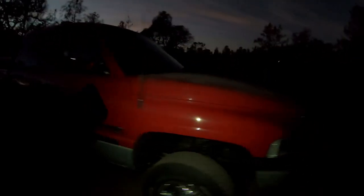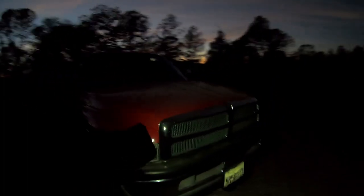And I will tow a tractor or something with this thing. It does feel like it's capable, but we need to add some more power to it. That's all there is to it. She don't have enough juice. Not enough RPM, I would say. I know diesel's got that low-end torque, but this one ain't cutting it. It ain't got enough fuel, ain't got enough boost. And I think I might have a little bit of a boost leak. I can hear something kind of howling at me, but she's still pulled.